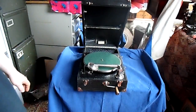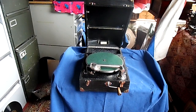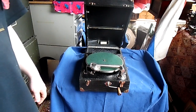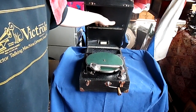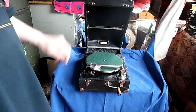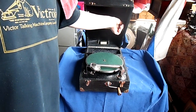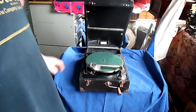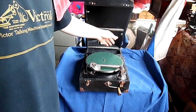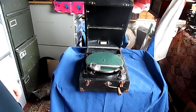A lot of people would say it looks incomplete because you're missing a record flap, but this is not true — the machine is complete. The only thing missing is a little cardboard flap that goes in here, which is loose, so it got lost; in some cases it was never sold with the machine. You open this bar like this, put your records in, push it back against the lid, and your records won't go anywhere.